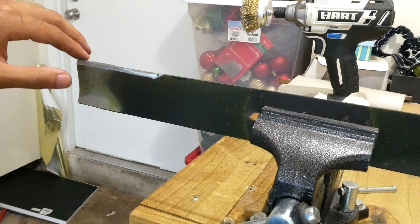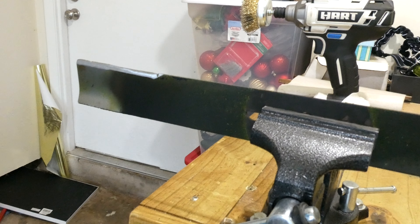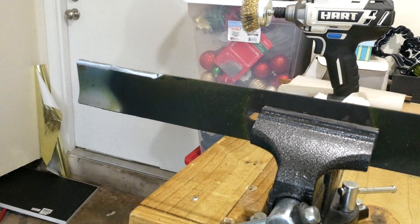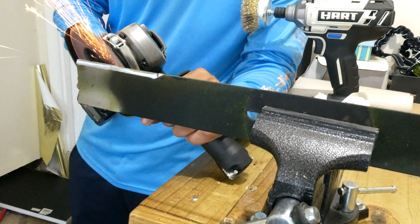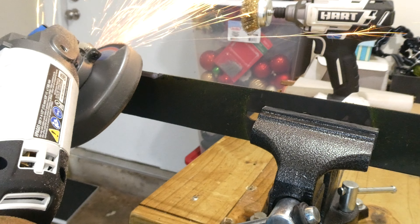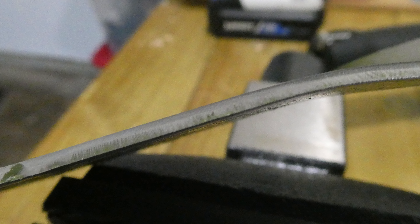It's going to be pretty quick. All it takes is a couple of passes on each side and you're going to have a blade way sharper than the one you pulled off the mower. For reference, this is what the blade looked like before I sharpened it — you can see a pretty big chip and a bunch of dings and bends. After you flip it over and do the same to the other side, it should look like this: a way smoother, cleaner edge. Still a little bit of burrs but way better than before — I probably chopped over some branches or something.